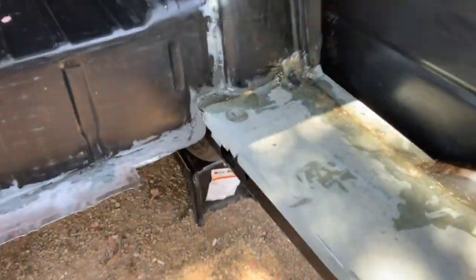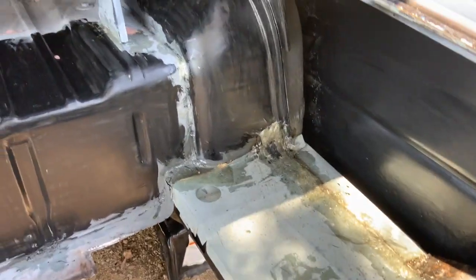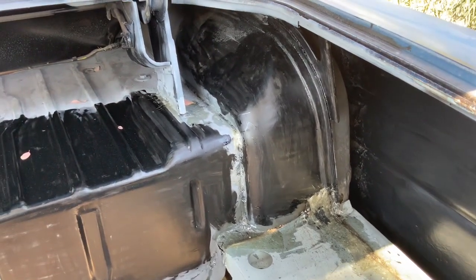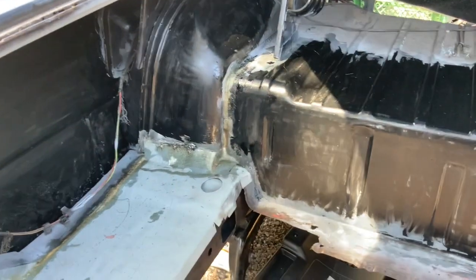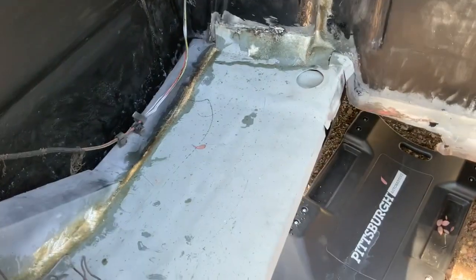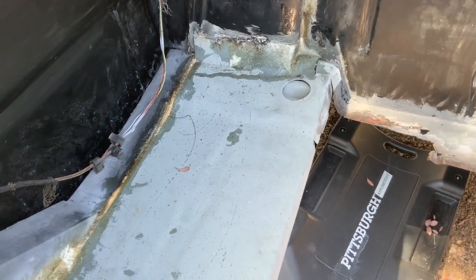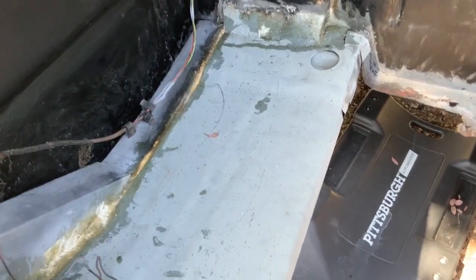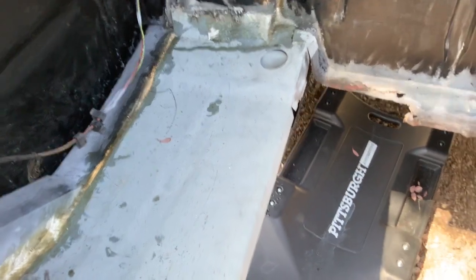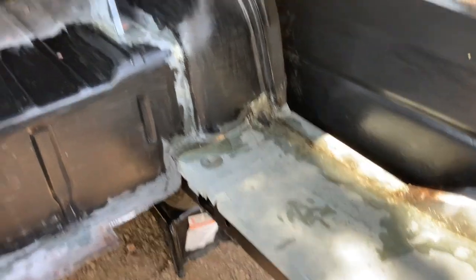All right. Okay, we are really in the home stretch now. We got these two end pieces in, and they're in really solid. This is welded in and then reinforced in fiberglass. And we went ahead up by the wheel wells there, reinforced that with fiberglass, a couple other areas. And some of these seams on the side, where the original drop off meets, there's just no way I could weld that together, and just cobbing it with seam sealer didn't seem like the right thing to do either. So fiberglass.